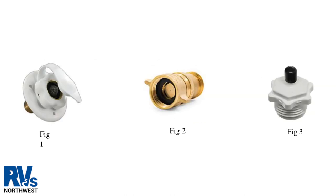Before pumping antifreeze through the water system, some people prefer to use air to blow out as much water as possible. This can be accomplished by using an air compressor and hooking up to the city water connection as seen in figure one. During this process you would want to use a pressure regulator (figure two) and a Schrader valve attachment (figure three). Most water lines in today's RVs are PEX tubing, which is rated at 45 PSI max, which is why it's important to use the regulator.